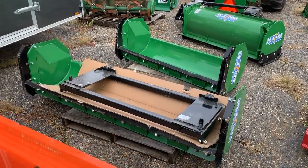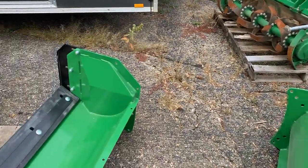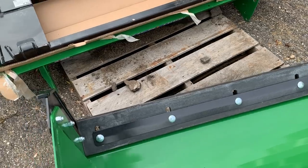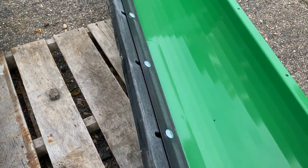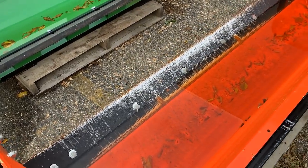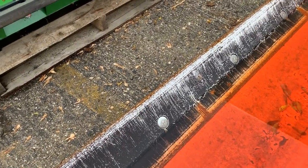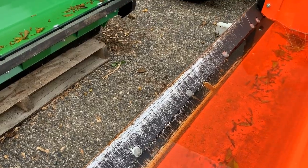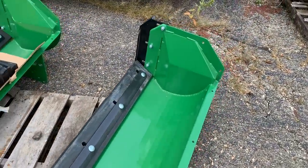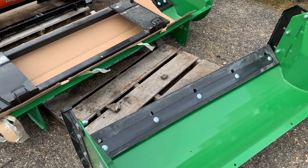Pick the right edge for you — and this applies more to snow pusher and snow plow users than snowblower users. When you've got a long edge that's primarily the scraping portion making contact, you can see this is a real thick rubber edge right here. I'm selling a ton of these rubber edges on snow pushers. You can also get steel edges. The steel is going to scrape cleaner — if you have that packed snow and icy surface, a steel edge will cut right through that stuff, a lot better than rubber will.